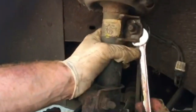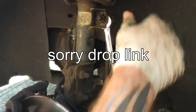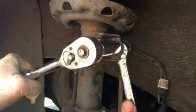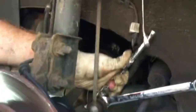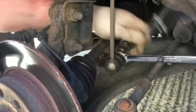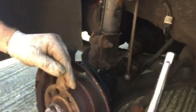Get your right size spanner onto the inner nut and just push it on there, then hold that in place — unless it gets caught on something, then that can do the holding for you. 19 on the front, anti-clockwise. You have to hold it in place and start unscrewing the top nut. A handy tip: if you cannot get leverage on the socket, put a spanner on the end as a lever and push on the top. After a lot of working at it — it's a very stiff bolt — I had a bit of WD-40 on there and we've got it loose.